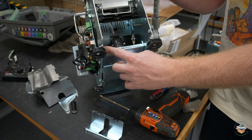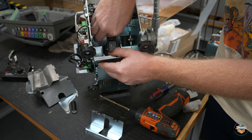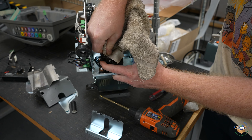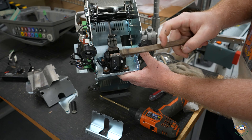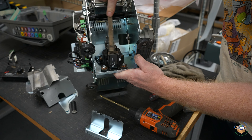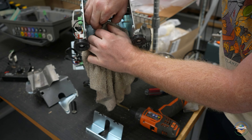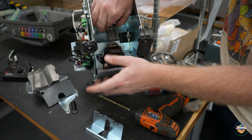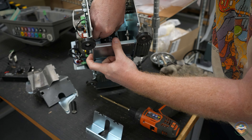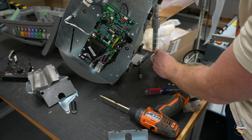Now that we have these two screws out from the front of this plate we can bend this plate down. At a certain point you'll have to pull this plunger up, but that allows you to access this solenoid. Take your rag and wipe it down — you can also use your steel brush and brush off some of that buildup, especially if your machine had a bunch of tape blown out down in here, which can really cause that machine to buzz. Now wipe down the plunger. At this point I'll go ahead and put the screws back in the lower plate.